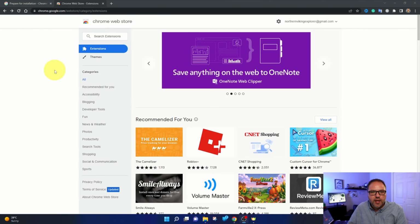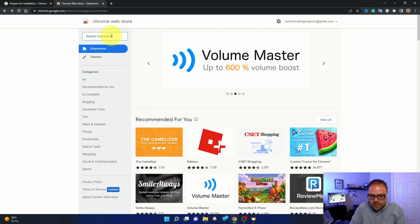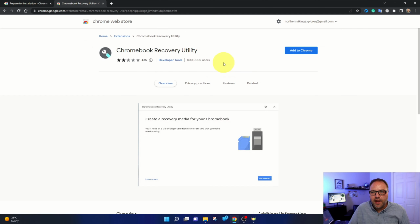Now what we need to do is go into our Chrome browser and load up the Chrome Web Store. I can put a link to what we're looking for in the description below, but what we want to search for is the Chromebook Recovery Utility, and it's right there, so you can just search for that. It should be the first one here that comes up. It says Chromebook Recovery Utility. Just go ahead and left click on that.